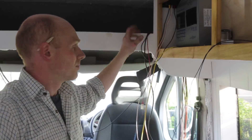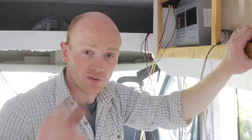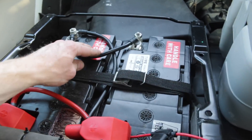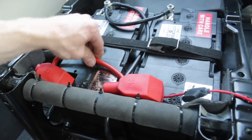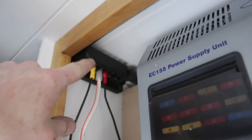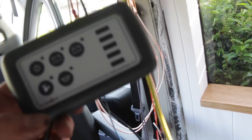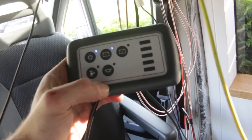Getting somewhere now. I've managed to put the negatives in — I've just done the lights and fan as a tester really, and we'll wire into the batteries now. Both batteries are 100 amp-hour each. This cable puts them into parallel — negative to negative, this negative goes to the chassis, positive to positive. Then there's a 20 amp inline fuse feeding the system, and there'll be another one going directly to the compressor fridge. Up here is where the negatives all go — the negative from the main loom — with ethernet cables coming in. Now we should be able to turn it on and we're on the leisure battery.